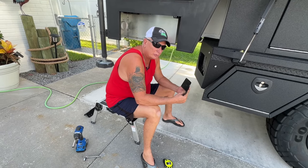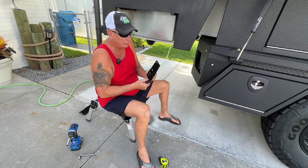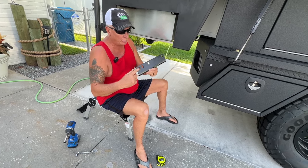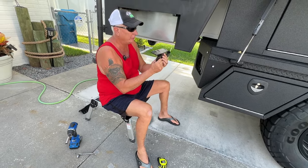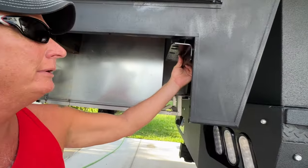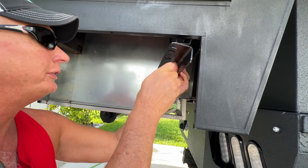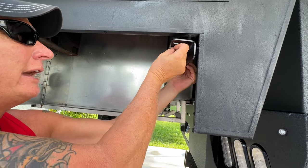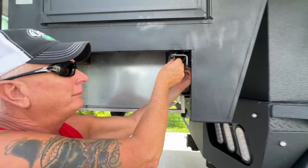All right, so we're going to install the Host Yukon specific brackets. You're going to see four holes here and two on the side. On our application, it's going to mount like this up in here on the original frame. On ours, we're going to line up these first three holes here, basically like that, put it in just like you took the old bracket out, and we'll go from there.